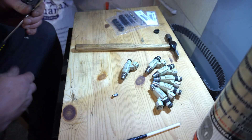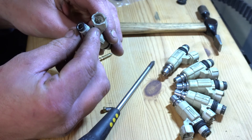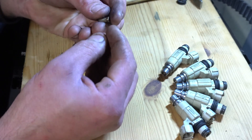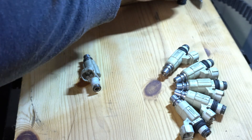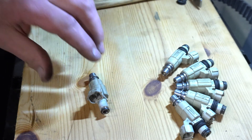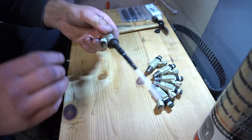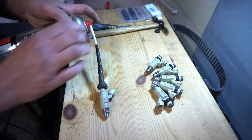Don't drop your filter on the floor if you can help it. There's your old filter — and now that's basically all you can really strip down. Down inside there is your delicate gubbins for how the actual fuel injector works. I want to take the new filter and stick it in — old and new are slightly different but they all do the same job. But before I do that I want to give it a clean out, so I'm putting everything to the side. What I've got is the little tire valve — I'm going to start by squeezing this on the end of the fuel injector. It's really tight, which is what you want, and I'll connect this up to my cleaning product.